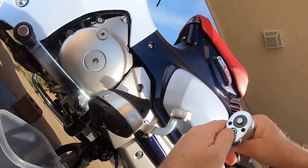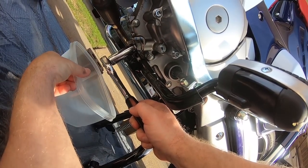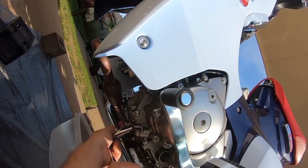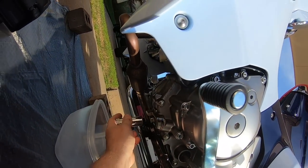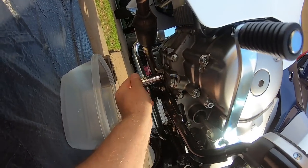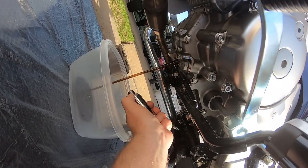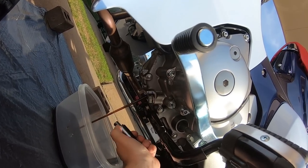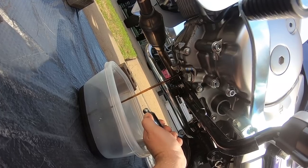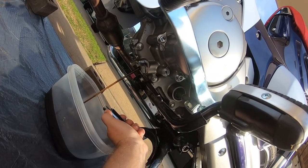17mm, lefty loosey. It looks like I'll probably get a little bit of a splatter on the exhaust, but that's expected — I'll just hit that with a shop rag and some brake cleaner. I'm not using nitrile gloves because I couldn't find mine. Didn't lose a drop, and I didn't even get much on me. The oil is already pretty dark, but these motors don't have oil filters.